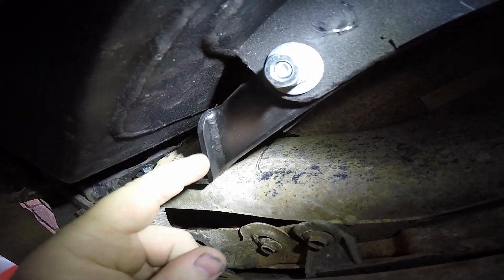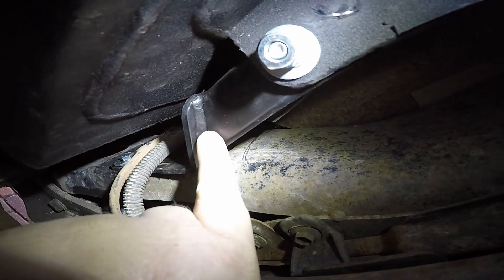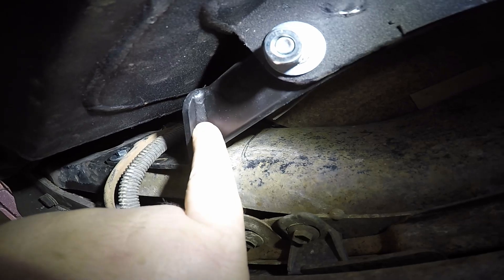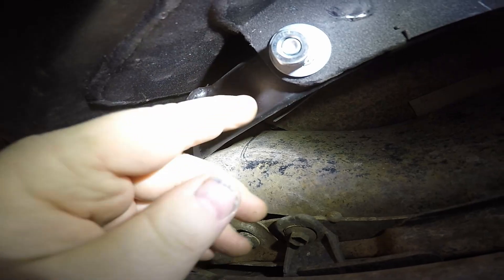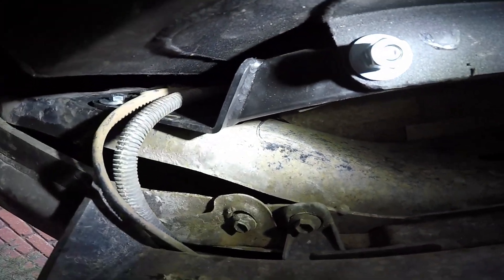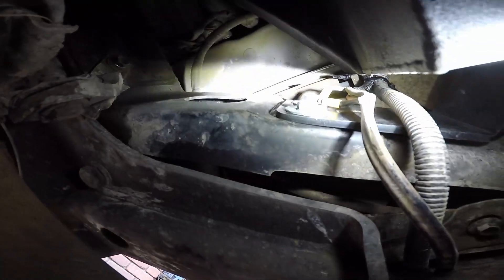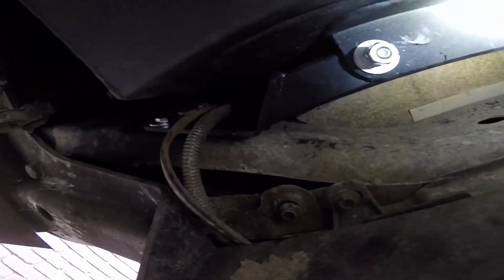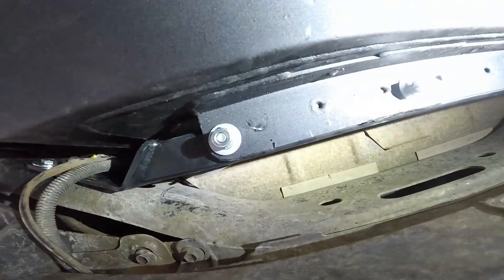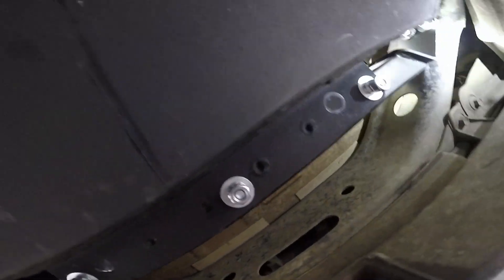You'll see the flat bar they've used here with this box section — this side is only about 10mm, the other might be 20mm, so the box section is the lowest possible point. I've put that flush with the back of the chassis bit there. Once you've got it sitting in, I used some G-clamps to clamp it into place and then removed the trolley jack, which is what we used to lift it up.